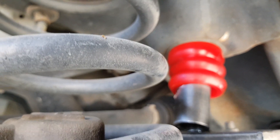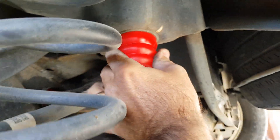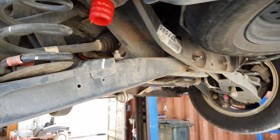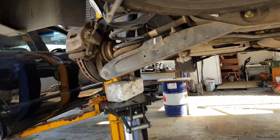If I let this down gently — see it all coming down here. Pull that out and she's installed. That is how you install a bump stop. You can push and pull and poke and prod and try and stick that thing on — it will not fit. You've got to jack it on using a jack.